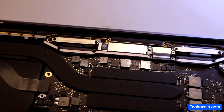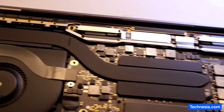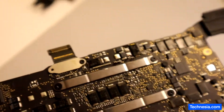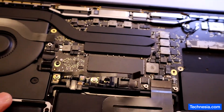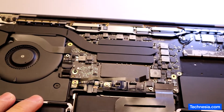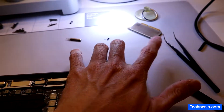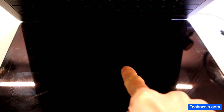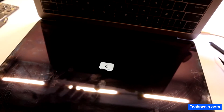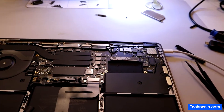I replaced the burnt component from this logic board with a good one from this donor board right here. I put some of the screws back and installed the logic board back. I'm going to test it to see if the MacBook is working. I'll leave the solid state drive out because I don't want to damage any files or data. We got a video image — that looks good! I'm going to put the solid state drive back into the MacBook and do another test.